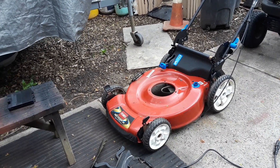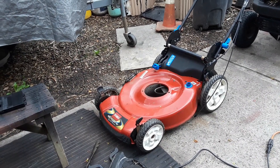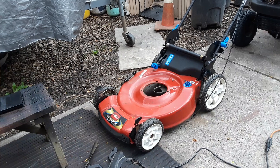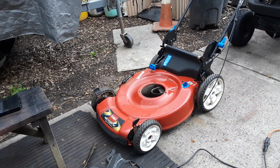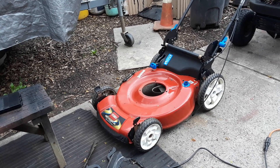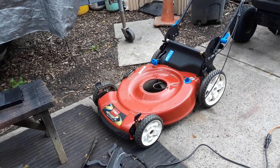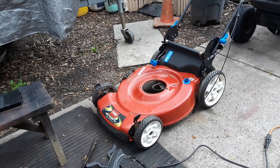Any kind of piece of power equipment — if it has a cord, you pull it. Make sure that engine is not seized first. I got fooled on this one because of how new it is and because the air box was off, so I assumed it was just gonna be bad gas in the carburetor — a carb cleaner, a new carb, a one-day deal.